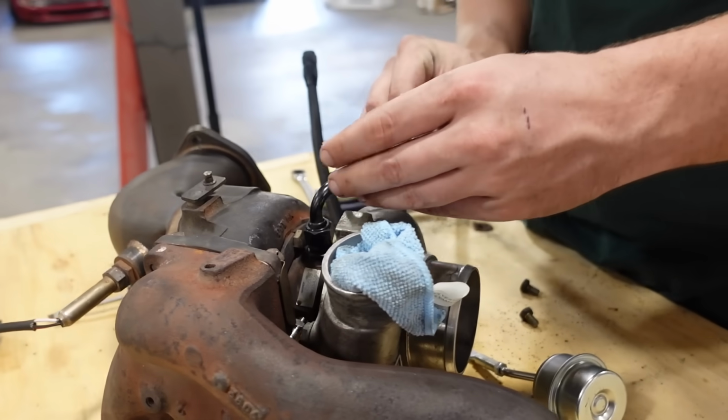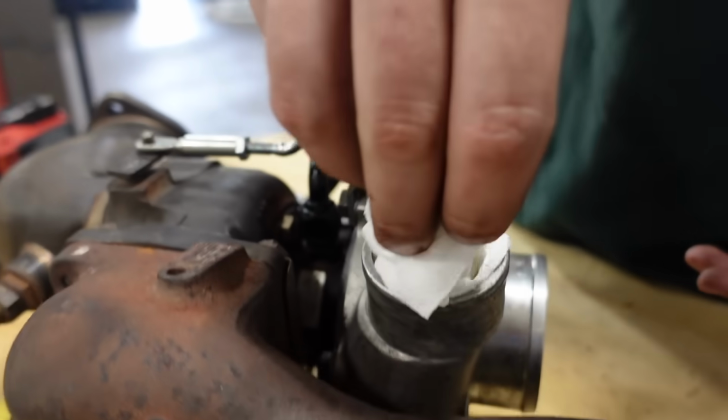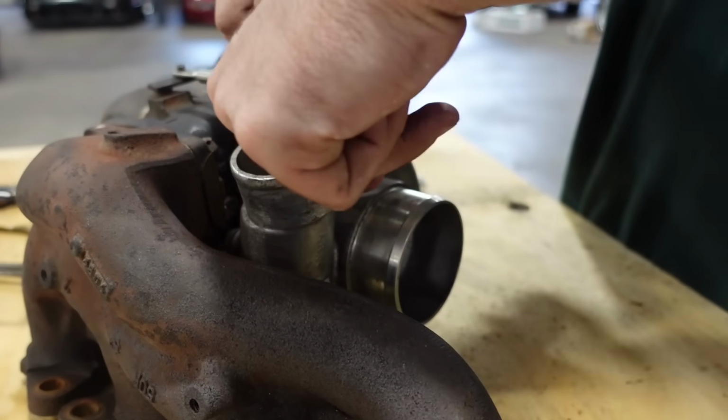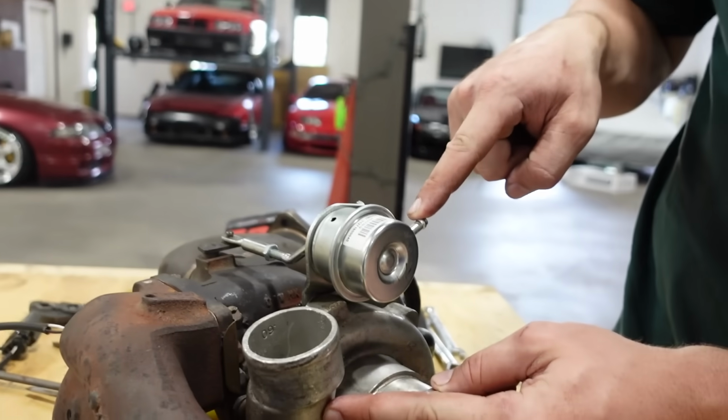And that's what I want to hear. All right, so we have the wastegate on, which will give us about 7 PSI, which is a good foundation. And then the next step that I like to do that makes things a lot more convenient is we're actually gonna put a vacuum fitting on the turbo itself for a reference for the wastegate, or else you gotta put a barb either in your intercooler piping or you take something from your intake manifold, which means you gotta run a vacuum line multiple feet.